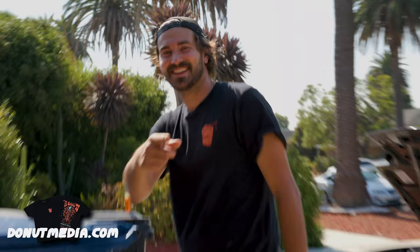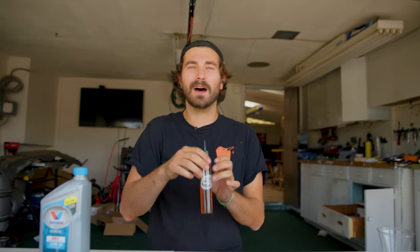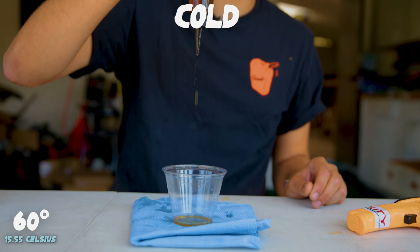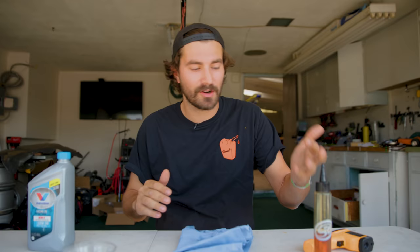The sun has got our oil up to a whopping 130 degrees Fahrenheit — only about double in temperature from 60 degrees. And you can already see just how much thinner it is. It flows so much more easily, hardly any resistance coming right out the tip. As you continue to get hotter, it continues to get thinner. That's good to a point — there's an operating temperature at which your engine oil should run. You don't want it running colder than that, which is why you shouldn't beat on your car until your engine oil is up to temperature — at least above around 150 degrees Fahrenheit.